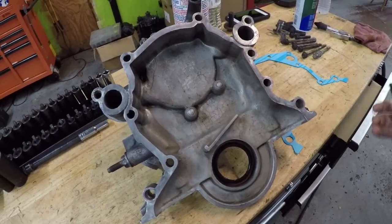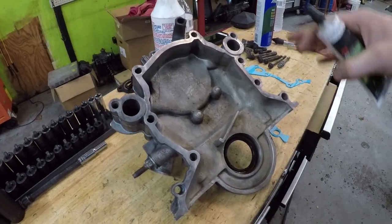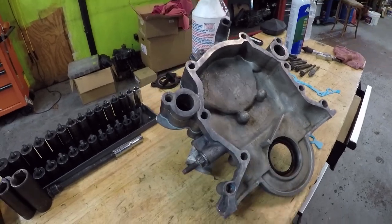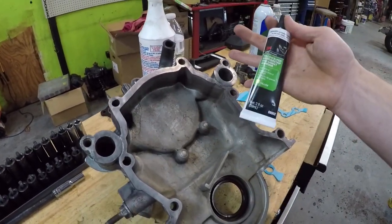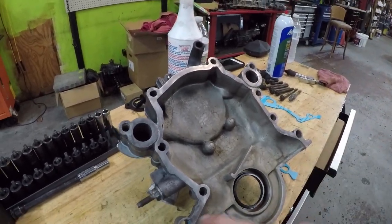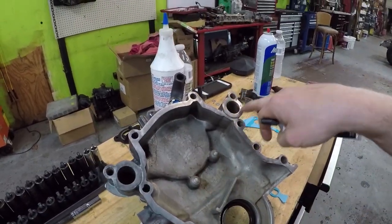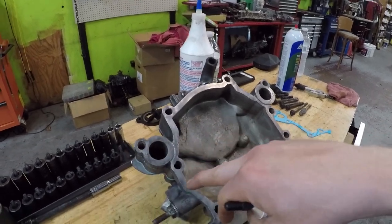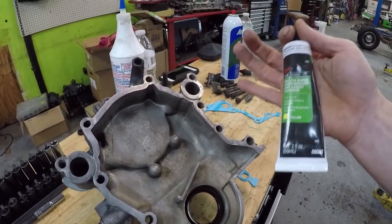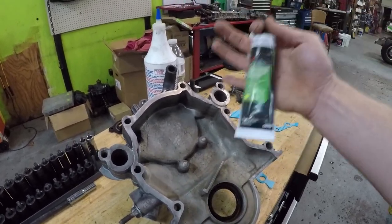I got my toolbox cleaned off a bit so I could actually work on it. Here's a little tech tip: as far as putting gaskets on — and this works for pretty much any gasket like timing cover, water pump, pretty much anything — what I like to do is take this 3M yellow glue and help hold the gasket into place. I like gluing it to the timing cover first. I just put a little yellow glue around the water ports and just little dabs here and there to help hold the gasket into place. This glue is really strong, holds really good, and dries pretty quick.